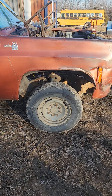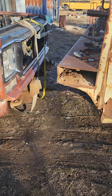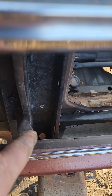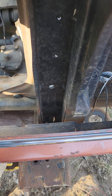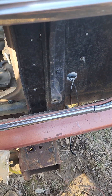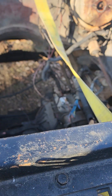I'm a semi mechanic and I don't like alligator hoods - it's easy to do a tilt front end on these. I'm pretty sure my mounts are going to have to come off and I'll have to do something different. As you can see right there, that doesn't quite line up with the frame. It's sitting a little bit to the right, and I need to square it all up and get it centered on the chassis.